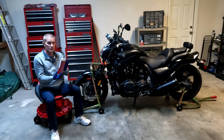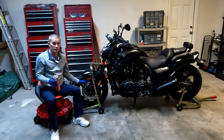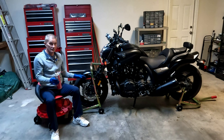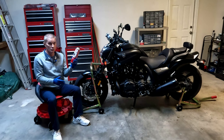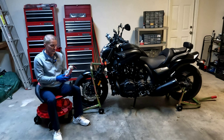One of the things I want to stress in this video is: regardless of what type of cleaner you are using on the brakes, you need to be aware of two things. One — does it leave any type of film or residue on the rotor itself? Because if it does, the first time you go to use your brakes you will know something's not right because there's not enough friction. If it's an oily film, you are not going to stop. That's one reason why I like actual brake cleaner — even if you let it air dry, it doesn't leave a residue behind and you're not in for a shock the first time you use your brakes after cleaning them.